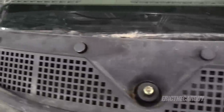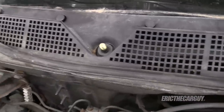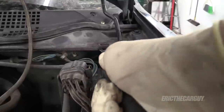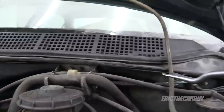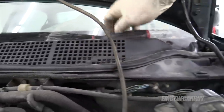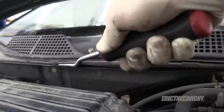These don't have to come out as shown — they just need to come up far enough to release the clip. If you have trouble, a little bit of WD-40 often helps. There are some additional clips holding the cowl down. I use a trim tool to help remove those. Sometimes I go under with a pair of pliers and squeeze the things holding them in place. Follow this rubber seal — you may find some additional clips underneath it. If you find them, pry them up, but be careful, this stuff is plastic.